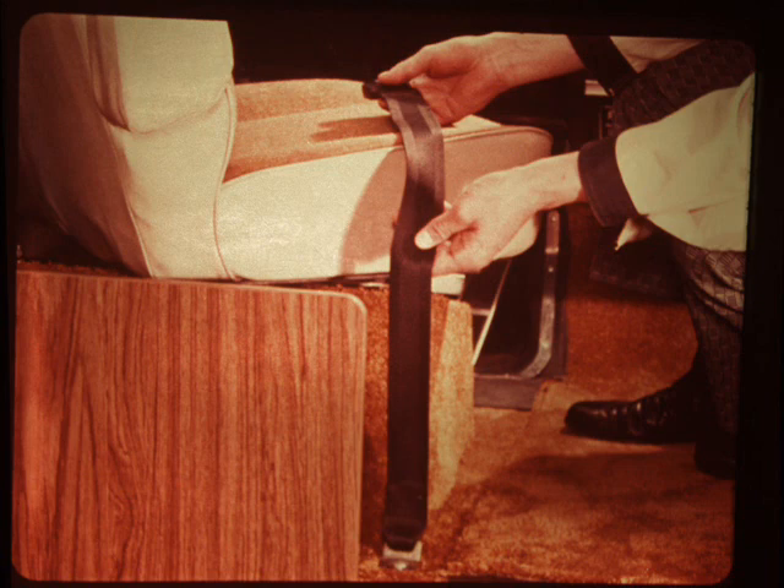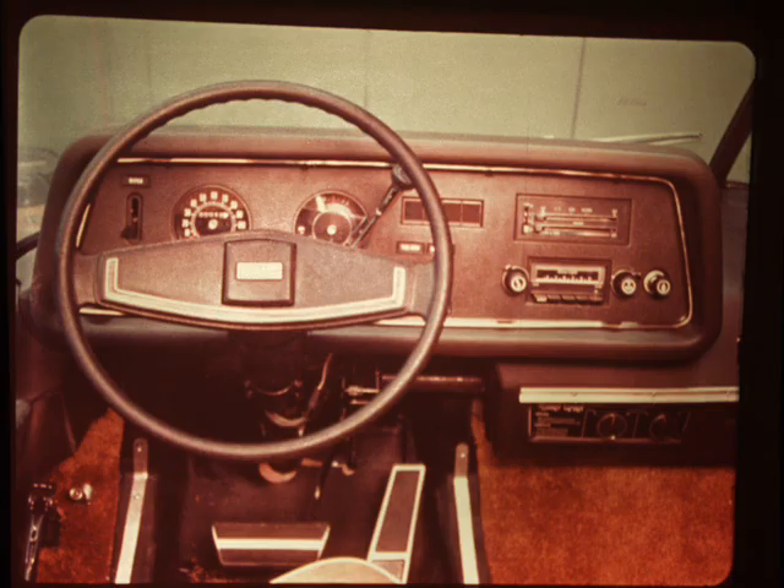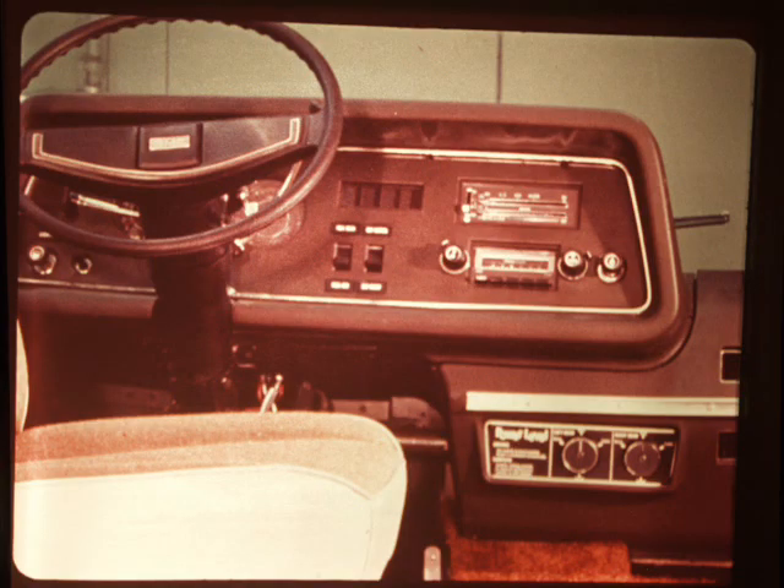Another thing related to the seats is the seat belts. Before delivery and periodically, the belts should be checked for damage such as cuts or fraying, and the anchor mounting bolts should be checked to make sure they are tight. The instrument panel and driving controls on the GMC motorhome are essentially similar to those in an automobile or light-duty truck — such as the speedometer and odometer, fuel gauge, and windshield wiper and washer. What may be new, though, are the auxiliary fuel, the battery boost, and the optional power level controls.